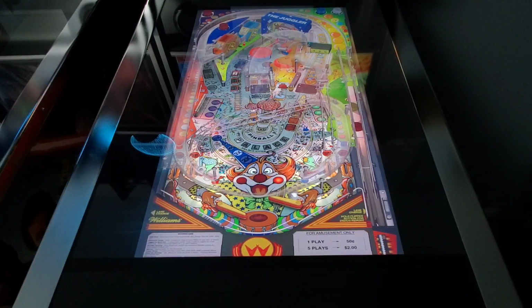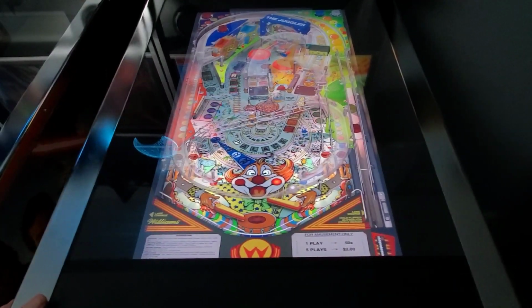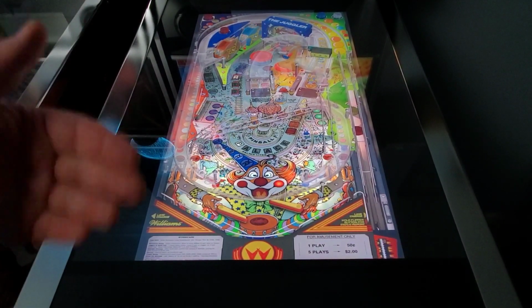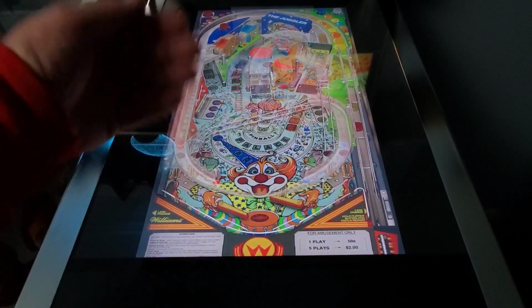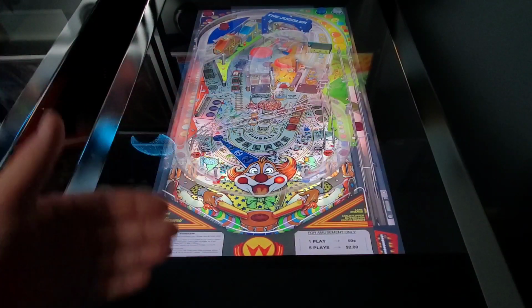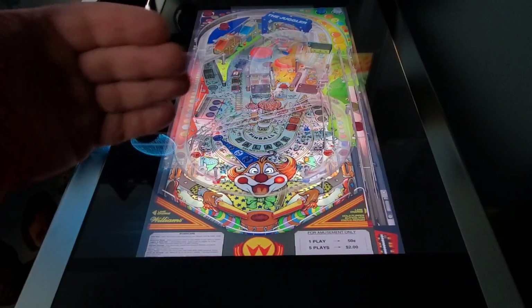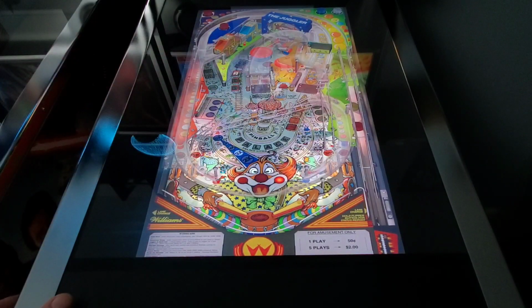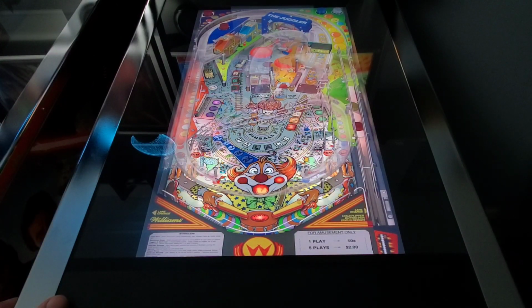That's looking good. I would know by now anyway, because like I said, there's a weird echo. When you nudge this, listen to the sound this makes. You hear that, almost like a sound of the ball hitting and everything. Well, that's what you hear constantly, even when you don't see the ghost nudging. You keep hearing that sound, so you know right away that the G sensor is causing that issue. But I'm not hearing that in any game. I'm not seeing the ghost nudging, so we're looking really good here.